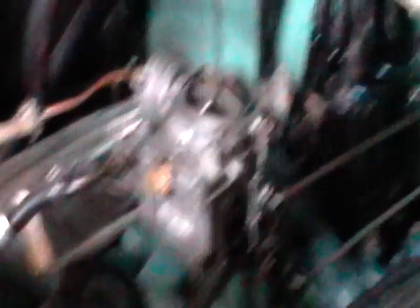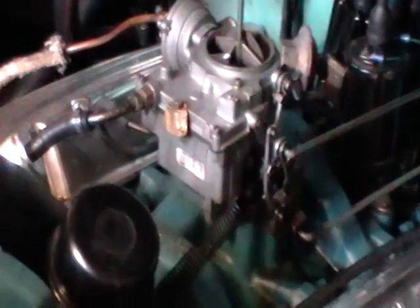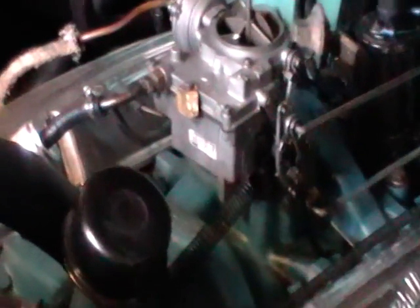It is looking pretty good, idling pretty smooth. We got it running pretty smooth. Once I gave it a little bit of rev after letting it warm up and then adjusting the air fuel mixture screws, I noticed it will backfire.